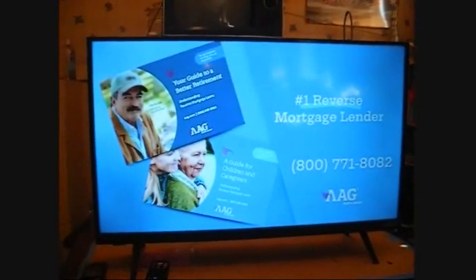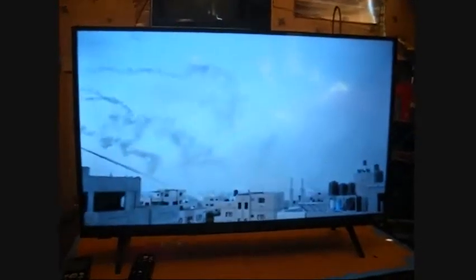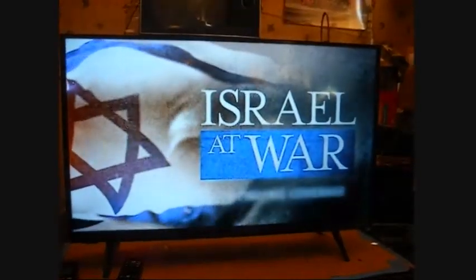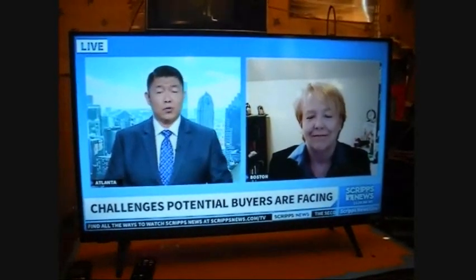All I've done to this TV is go into the menu and turn the backlights way down. Since that's the most common failure on newer televisions — the backlights failing because they run them wide open — I turned them way down to try to conserve their life. If you have a modern flat screen TV, I'd recommend you do the same thing. Yes, you'll lose some picture brightness, but you'll gain some life. If your TV doesn't have a dedicated backlight setting, try enabling the power saver mode, which will usually dim the backlights.